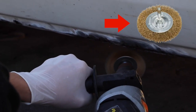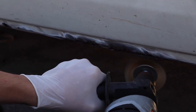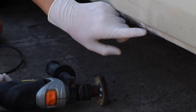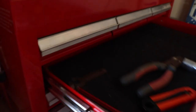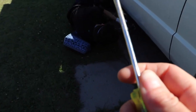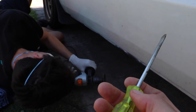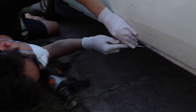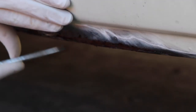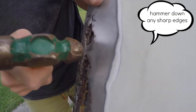The first step is to get rid of as much of that flaky outer rust as possible. We used a wire brush attachment for our drill to grind it all away. For the places that were a little bit hard to reach we also used a screwdriver to chip away at the rust. However you do it, just make sure you get as much of that brittle rust off as possible, otherwise it might break off when you're applying the filler and you might not get that really smooth finish.